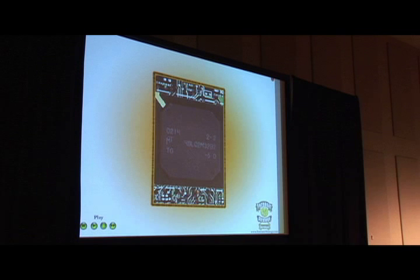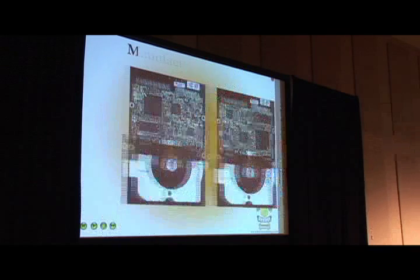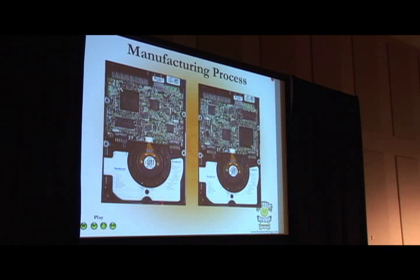The most important thing on these chips is the firmware. From one manufacturer to another, you may have changes even within a week or two-week cycle. In this case, this is an IBM hard drive — the chassis and platters are made at one particular manufacturer, but the board may be manufactured at two completely different places. One week made in Korea, the next week in China. As you can see with these two boards, it's the exact same hard drive but they changed the model number and manufacture date. Every hard drive has that date on it for this reason — if they don't know when it was made, they don't know which firmware was used.